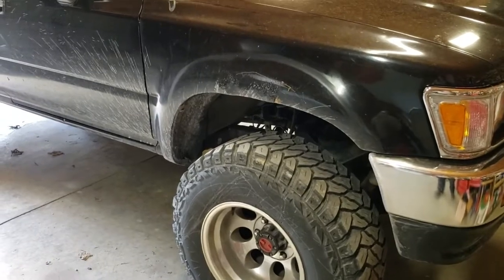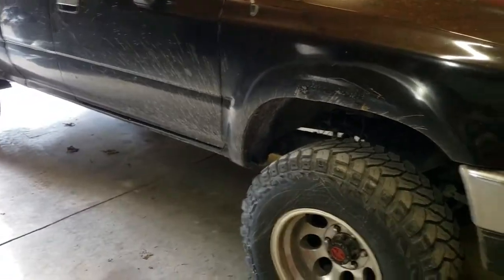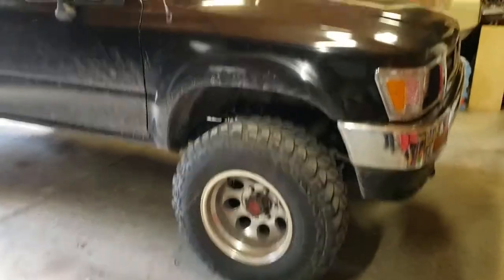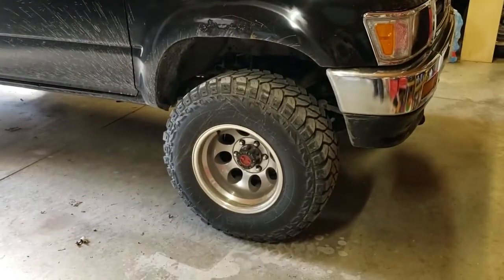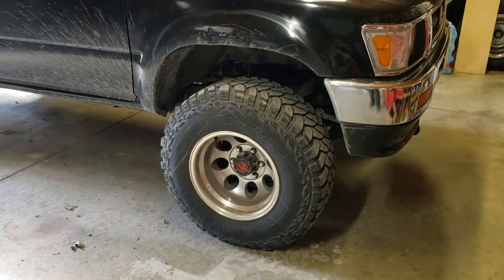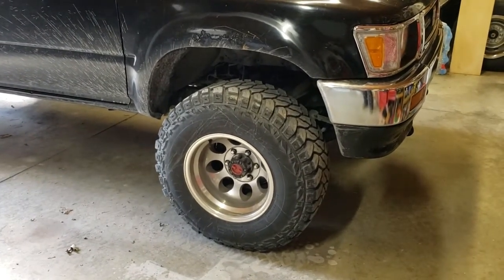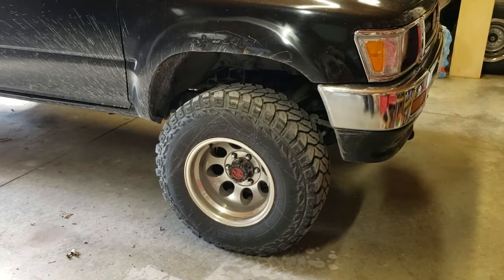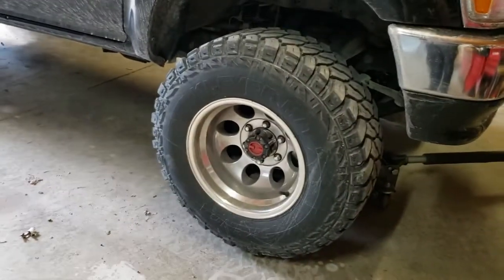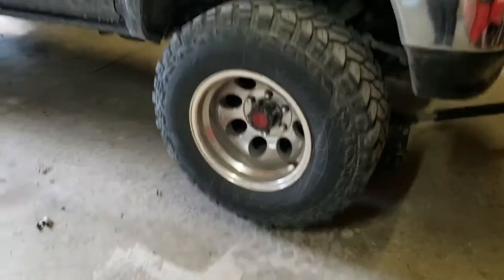You can see the fender — I do have a new fender and a new tailgate for the truck, it's in the barn. Have to wait for warmer weather to get it painted; rust is coming through. I'm gonna get this thing up on jack stands and we're going to turn the wheel, rotate the tire, and see if it makes a noise. I believe the squeaker pad is rubbing. I've got it raised up with just a jack, got the tire and wheel off the ground by a couple inches.